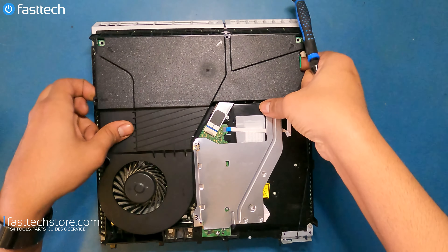We're going to lift the antenna out. It goes under the disk drive cable here as shown. You pull it out, and as you can see upon closer inspection, you can clearly see that this is a busted-up antenna. There's a big gap in between here, and that's a solder connection that's broken. There's a wire that runs in between, but in this case, it's busted.